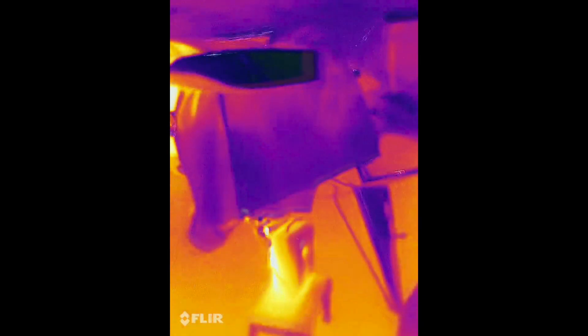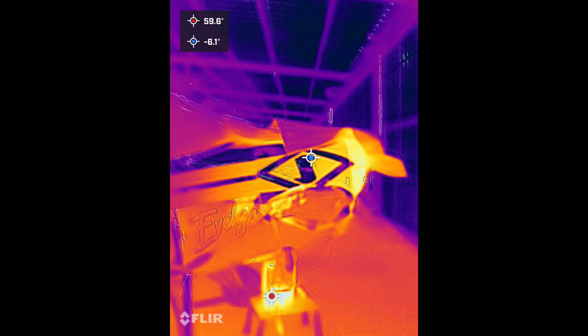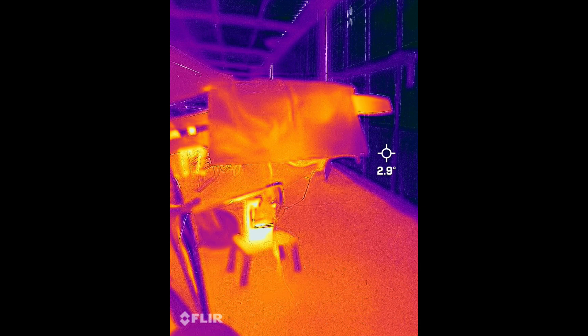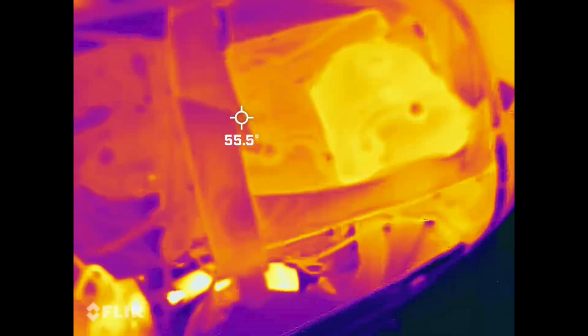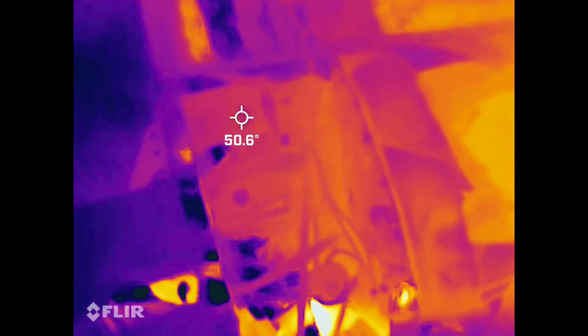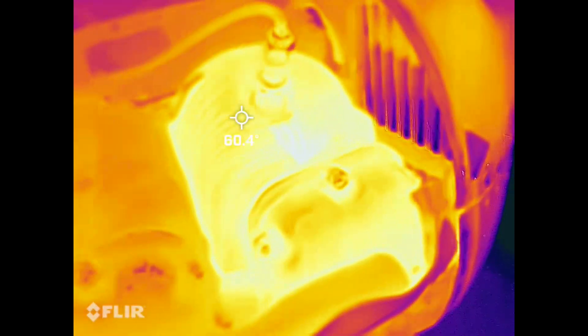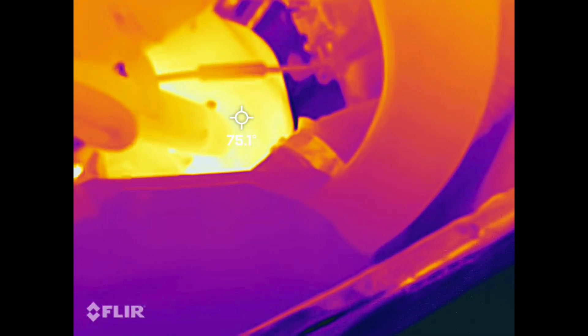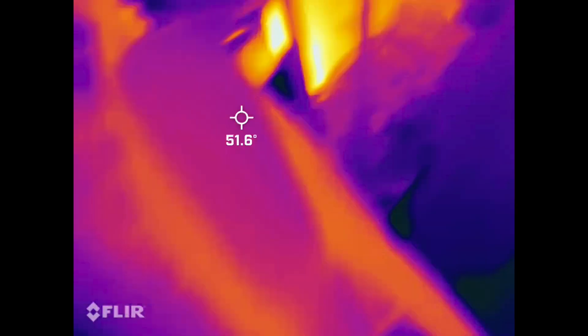Here are the components: the moving blanket which I'll leave on for now, the milk house heater, ducting running up into the engine, and an oil pan heater. The duct from the space heater is directed underneath the cylinder heads, and all of that is insulated with the blanket. The switch unit up here is reading 64 degrees. Looking at the thermal imaging, the upper half of the cowling is warm and the lower half is cold — the upper half is painted and emits heat, while the bare aluminum lower half just reflects the background. The front cylinder is warmer than the back cylinder because the duct is aimed more forward. The oil sump is glowing thanks to the pad heater, and you can see the actual heater itself as a white hot spot.